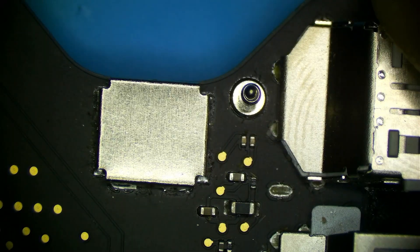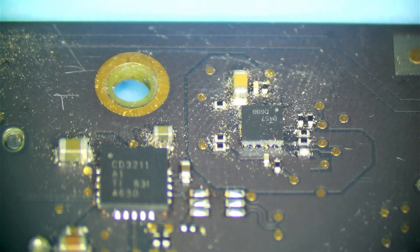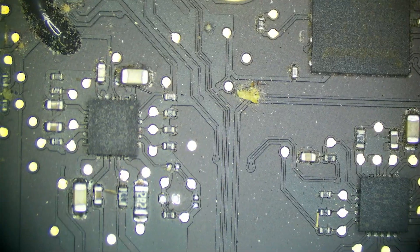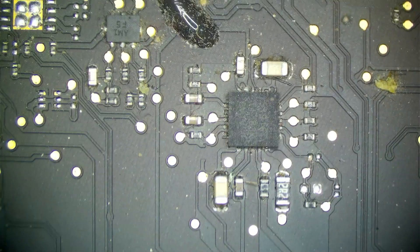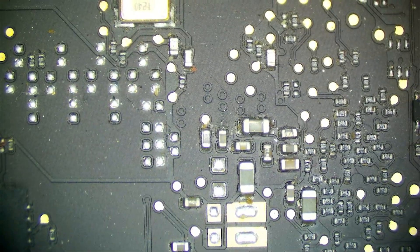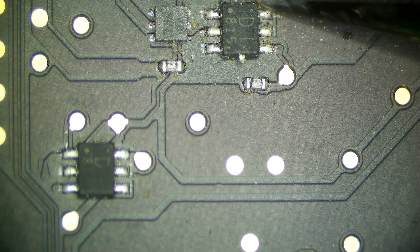Let's go ahead and give a look over of this board. It's a little bit dirty but doesn't look overly bad. We have this usual dust collection that happens on pretty much all of these after they've been in use for a few years. There's no real corrosion. What I'm looking for here is obvious corroded resistors or traces — you'll see green collection on probe points, stuff like that. SPI termination resistors can cause this, but this just looks dirty, just filled with small crumb particles.